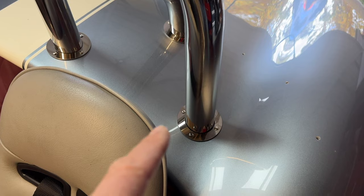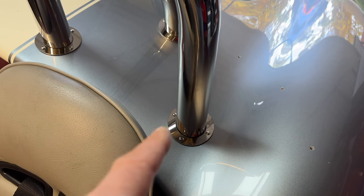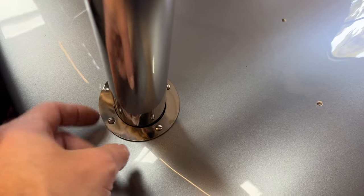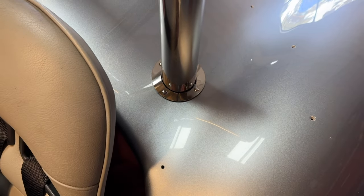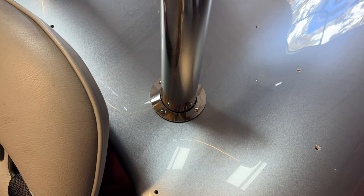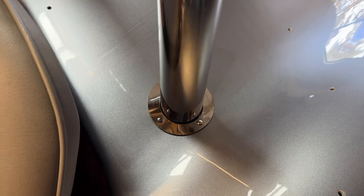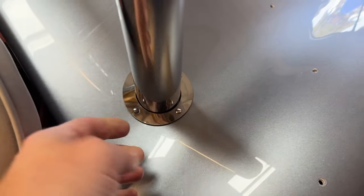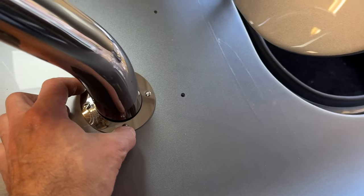Next battle: a couple of holes have been filled in by the body shop, so I just had to tentatively open those out. I personally opt for slightly larger holes than the actual screws so they can just drop through. You can see this is wobbly - they just drop through so I'm not screwing straight into the paintwork. I'm going straight through into a flat spring nut on the other side, just so I can have that movement in case my holes are just slightly bigger than the screws.